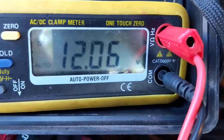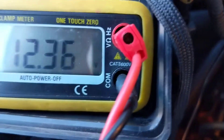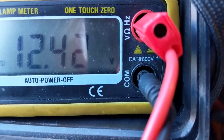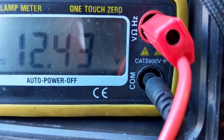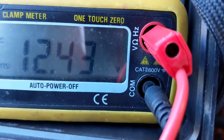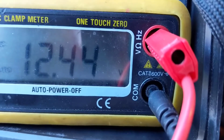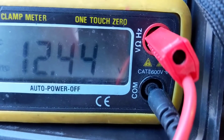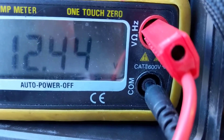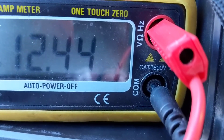Look — 12.07. The headlamps are working. Now let me turn off the headlamps — watch it go back up. Did you see it go back up? It's now 12.4, back to normal. Why? Because we're not drawing current from the B+. We dropped 0.4 volts. What does that mean? That means it's pulling current. The fact that I go from 12.4 and it drops to 12.0 — losing 0.4 volts — alone tells me this relay is working, because it is drawing current. When it draws current, you have a voltage drop from the B+, and the B+ drops from 12.4 to 12.1. That tells me voltage is dropping across the B+ itself, which tells me it's working. Very important to understand that theory.